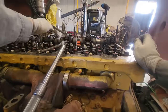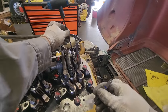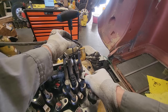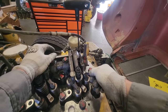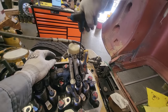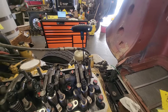We've got our intake here at 15 thousandths. We're doing intake on 1, 2, and 4, and exhaust on 1, 3, and 5. I put little blue lines on the feeler gauge to differentiate it from the exhaust gauge — blue for no intake, and then I'll put red on the exhaust. The way I do an adjustment: I put my feeler gauge in, run it over-tight so it's pushing the valve down, then back it off until it's loose. I make sure the bridge is in place, insert the feeler gauge, go finger-tight, and then just torque the nut. That's how I always do overheads — very consistent.